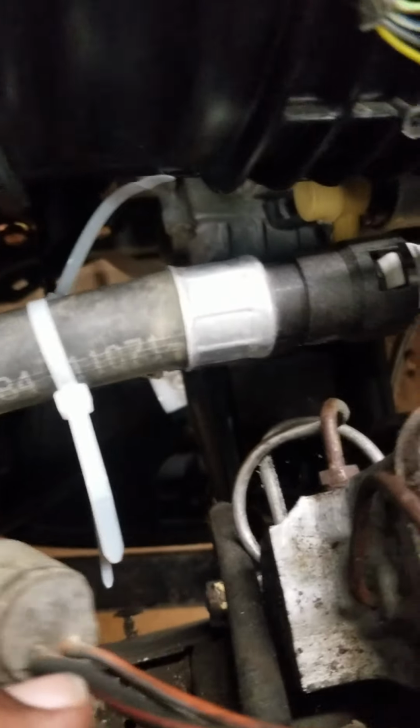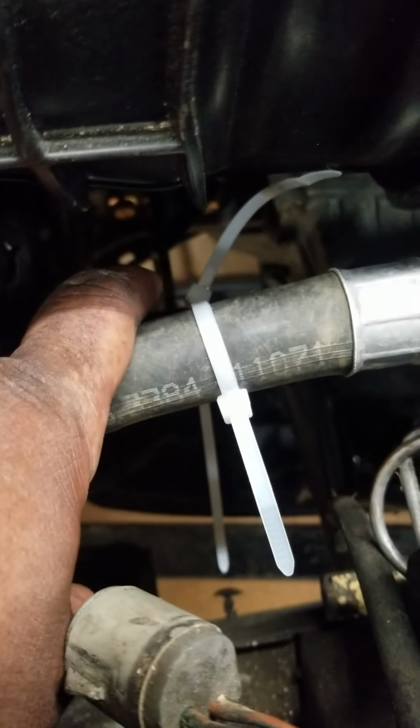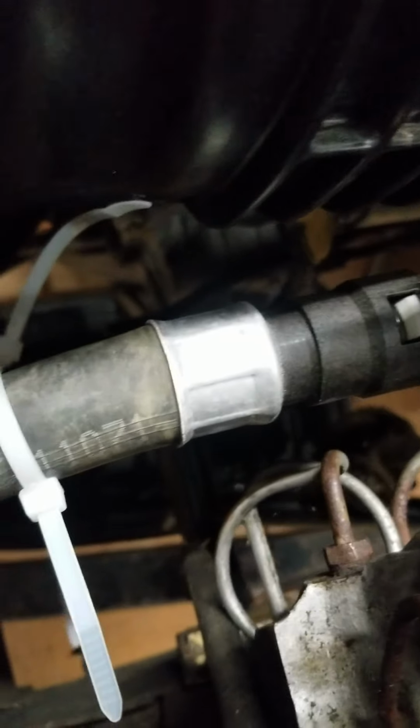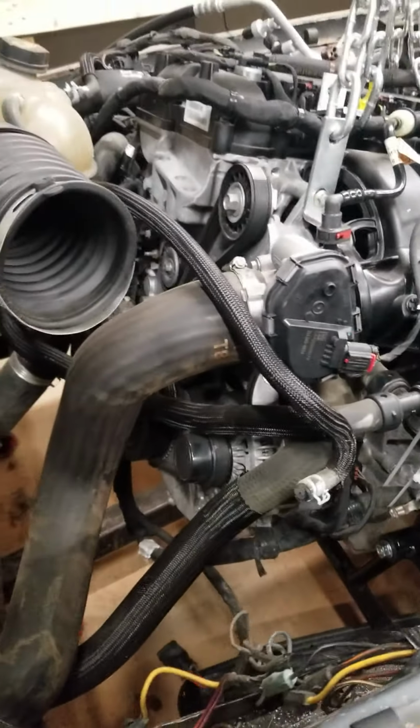But we'll get there. We're close. As you can look down in there, you can see the flange for the motor mount, and you can actually see the K-member flange right below it. So it's all about going back probably about 2 inches. Probably a better look right there, but yeah, go back about 2 inches, and this thing will be over in here.